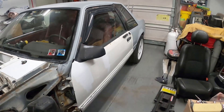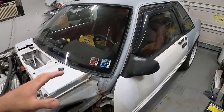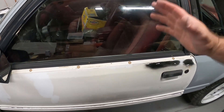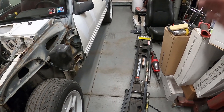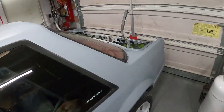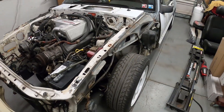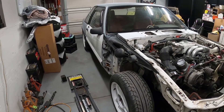When you panel paint there's probably gonna be some variations, so what I'll do is try to mix up enough paint when I spray this that I'll have enough already pre-mixed and reduced. It is a lot easier when it's a simple color - white. Panel painting white should not be that bad. You'll see variations but it's not gonna be as bad. Maybe I can paint the doors and the fenders at the same time so they're not so bad. We'll get this whole back section done, then I'll probably do both bumpers at the same time, and then the hood, fenders, and doors. When you don't really have a set place to paint it does make it a lot harder than it needs to be.